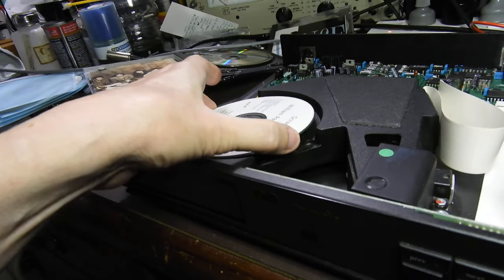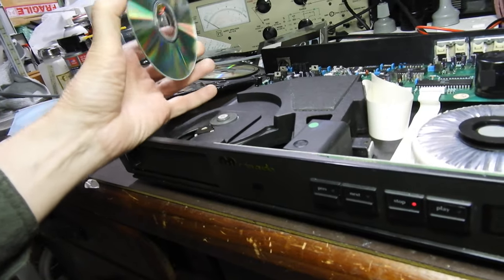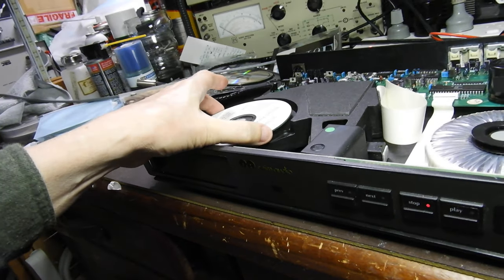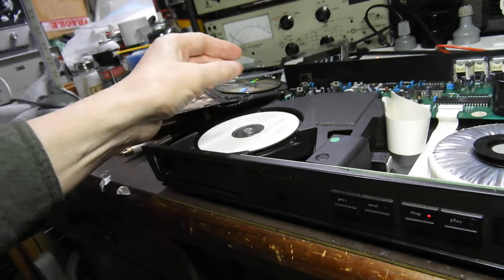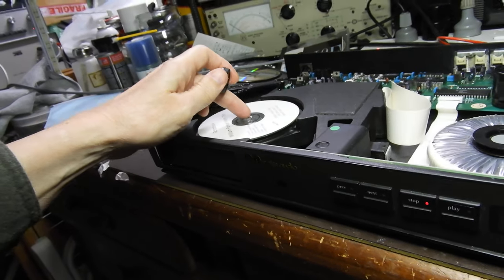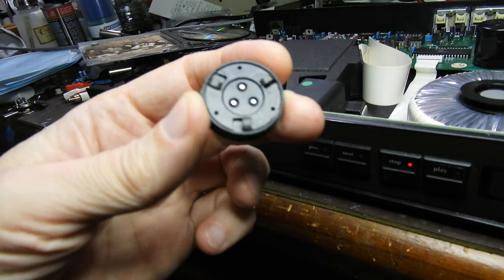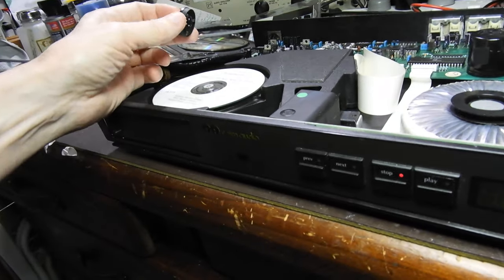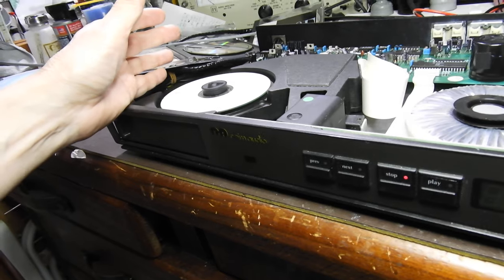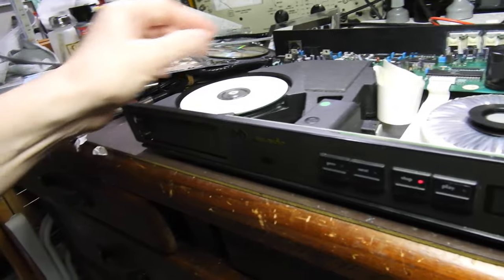Now the turntable is brand new — this is a whole laser assembly taken from another CD player that was almost unused since new. But with that magnet in the middle, what really mates are just those three metal studs, so it just doesn't have enough force to clamp it. It's enough when a CD is perfect, but if it isn't, I have several CDs that just won't play on this.